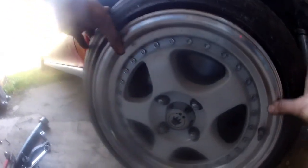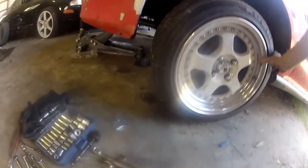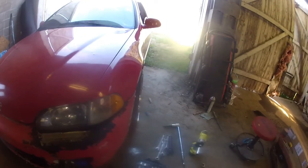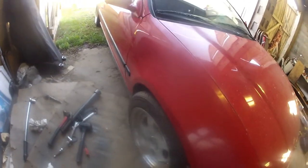This side's all done. Luckily that boot was still in good shape, so it's all how it's supposed to be — everything's torqued and wheels are back on, and all the slop is gone on both sides. With the wheels on we can really see how far off alignment we are. Driver side is straight but the passenger side is toed in a bit.